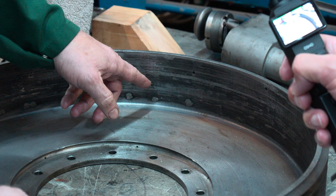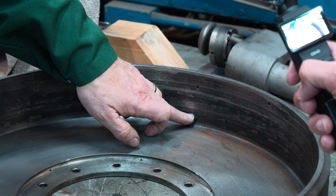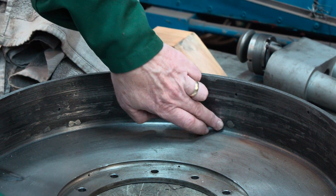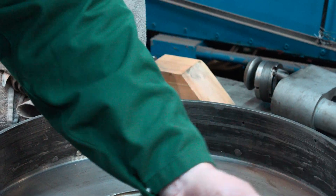This is actually pick-up from the cast iron when the brake shoes have been working against the drum. All these little lumps here — and they are lumps, not hollows. It's drawn material out of the surface of the brake drum and deposited it further around, so it's not smooth at all in there.